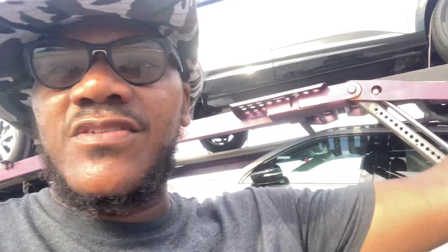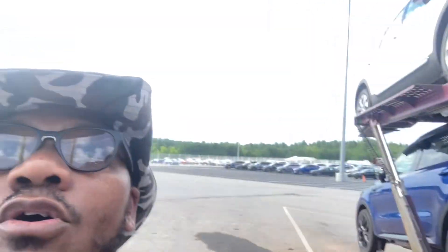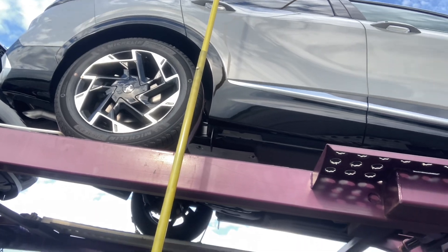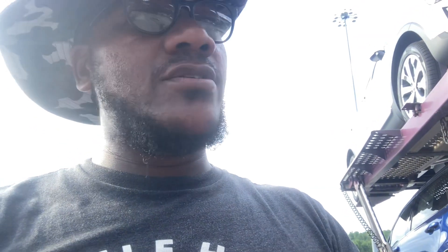That first vehicle height is like 12.7, 12.6 when the pole is all the way in the air. For rookie car haulers, get your height stick and use your height stick. Don't be arrogant. On this particular load, I'm a little bit high, as you can see all the way up there. Get your height stick up there, swing it up there, and make sure you check your numbers. I don't like to be over 13.8 with a full load. I like to keep everything under 13.8.